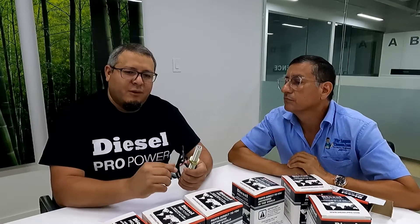We have two options — we have this magnetic pickup in two different sizes: three-quarters and five-eighths. The main function is just like the word says — it's a sender that picks up the magnetics. What it does is read the amount of teeth in the flywheel. Once you know the amount of teeth on the flywheel, you can get that information with the serial number. Then you calibrate the tachometer — for example, if a flywheel has 113 teeth, you calibrate the tachometer so that every time the magnetic pickup receives 113 pulses, it will send a signal for one RPM.